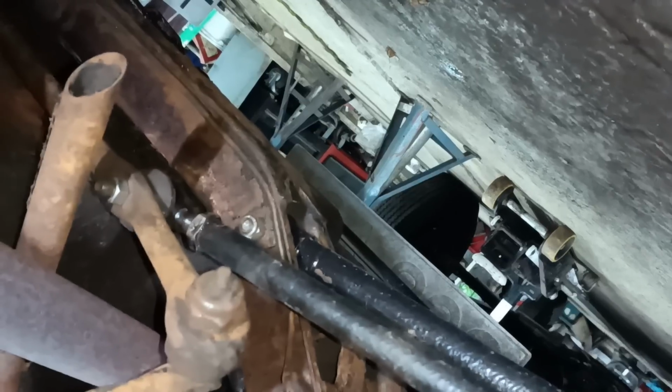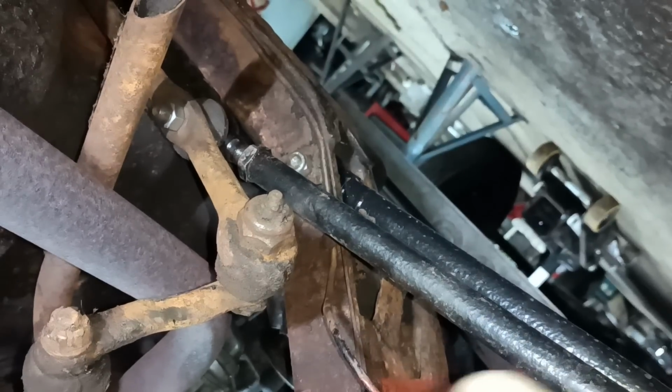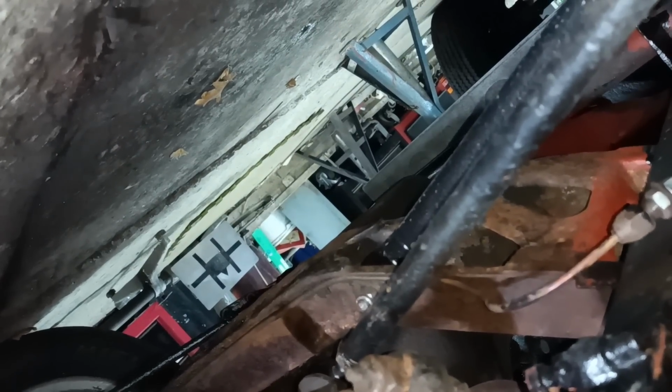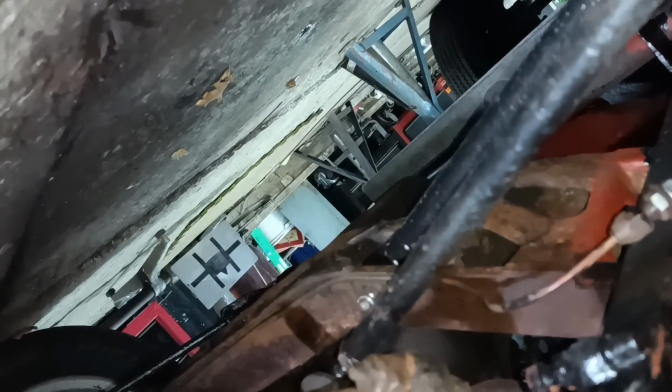Now, hang on, it's towed out now, so I need to lengthen this rod, don't I? If that's a right hand thread at that end over there, I need to turn the rod sort of anti-clockwise from this end that I'm looking at. Hang on. So if we're going upside down. So let me see if I can give this just a little twiddle like that. Okay. Now I'll give the steering a wobble and bounce it up and down a bit, and then take another measurement. I didn't look to see how far I'd move that then, but let's just see what that does for us.